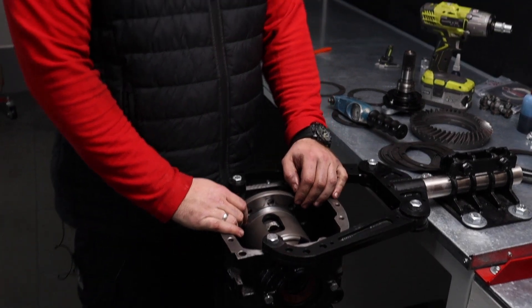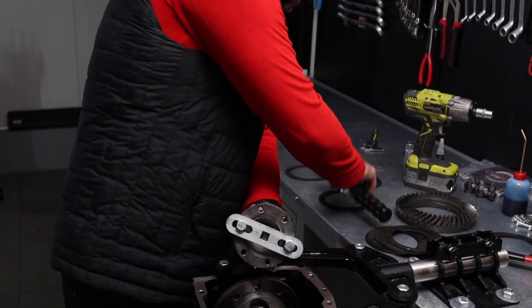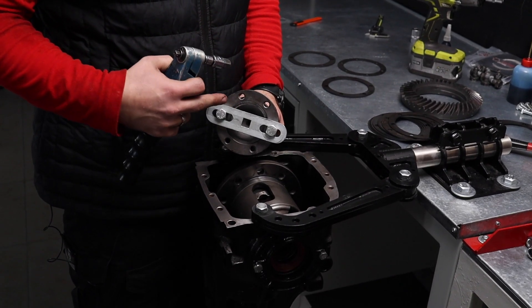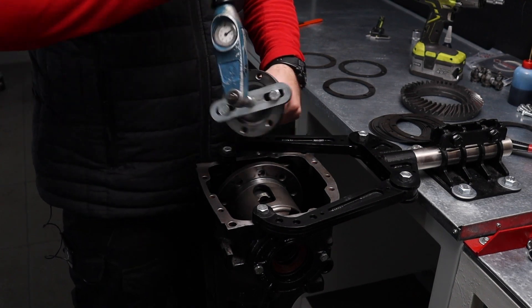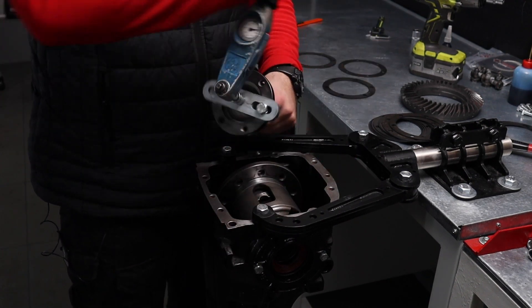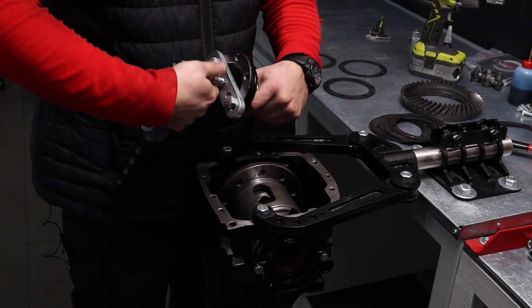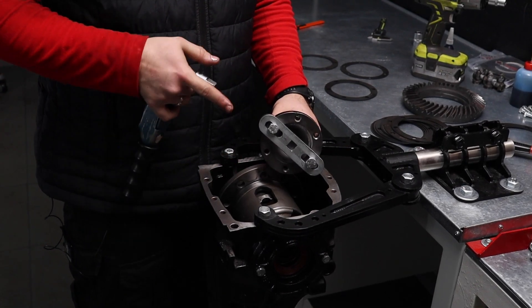As you can see, the differential now spins more easily, so we've reached the point where we can do some actual measuring. To do the measuring you need the dimension adapter for the output flange for the torque wrench. This adapter can be purchased from our web shop as already mentioned, and it serves to let you attach the torque wrench to the output flange so you can measure the torque resistance, or carrier preload as we want to call it. We're going to show that now and talk about some values.